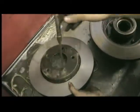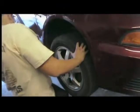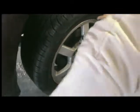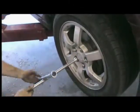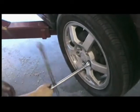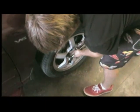Use solvent and a brush to clean off the rotors. Slide the rotor back on. Slide the brake pad back onto the rotor and put the bolts back in to tighten it on. After you tighten the bolts on the brake pad, put back on the tire. Hand tighten the bolts back onto the tire, then tighten the bolts back up, keeping them loose at first. Lower your car back down and torque wrench the bolts back to your car-specific settings.